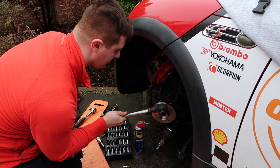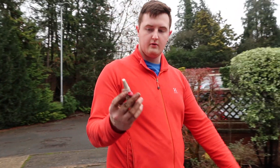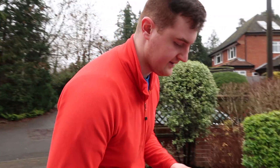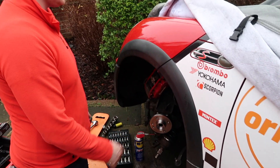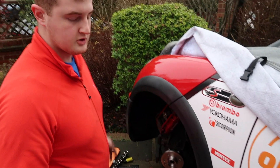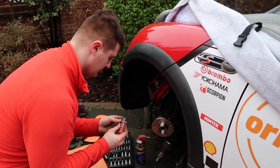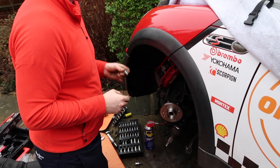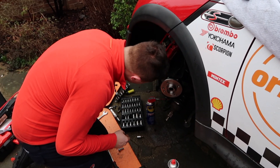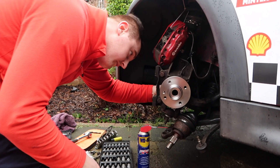I just don't have a soft blow mallet at the moment. Hopefully I've lined that up pretty well. So we've got some Loctite now — we use Loctite 270. This is like a high temperature rating, also good for wheel bearings and nuts like that. I use it on the lower control arm, because obviously the one thing you don't want to lose is suspension. I also use it on the lower wishbone. The majority of the time you don't need to Loctite things — it's only in areas that are going to be really high vibration. Just a teeny weeny little bit of Loctite on here, just on the end of the threads, and you just kind of wrap it around your finger. I did line it up, which I did. I won't have to replace this wheel bearing for a long time now.